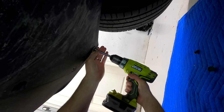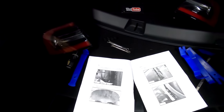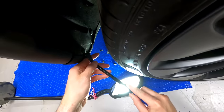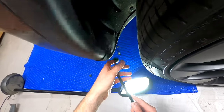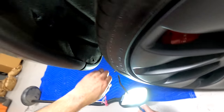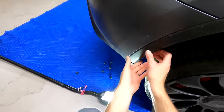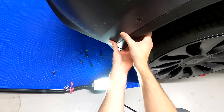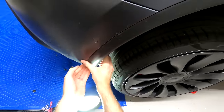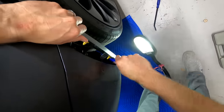One bolt spun - that's going to be a problem. That means someone at Tesla stripped that - thank you, guys. We also need to get the wheel well ones. It just says the one because it's broken free right there. You just grab and pull firmly but gently. I'm prying away from the car. Don't worry if things pop off - they go right back in. These cars are put together like Legos. That's a smaller one - looks like an 8mm, yep, just one.